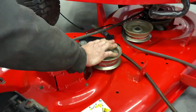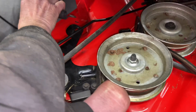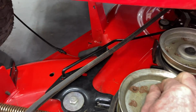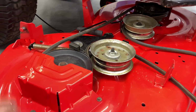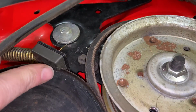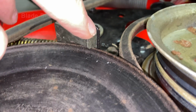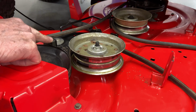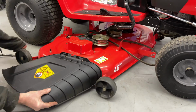So we're gonna go ahead and push the outer pulley all the way back. We're gonna hold it, come up from the bottom like that, like so. And you release this slowly. Now as you can see right here, I just wanna point this out. These are known to wear, right where this is. This one isn't all the way through yet and it still has about half of its life. I have a video on how to replace this brake pad itself, and I'll put that in the link in the description below.